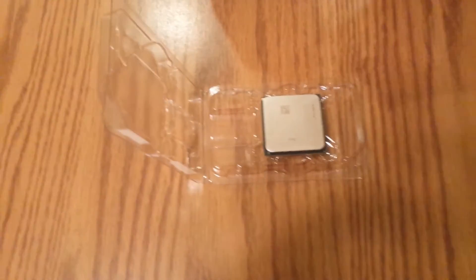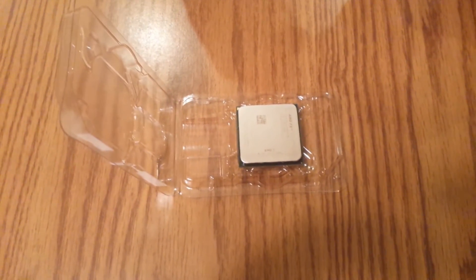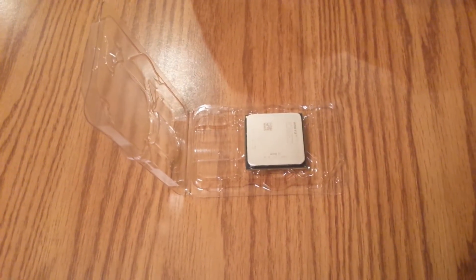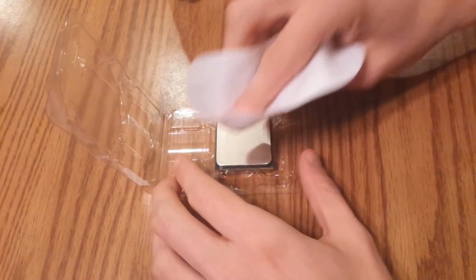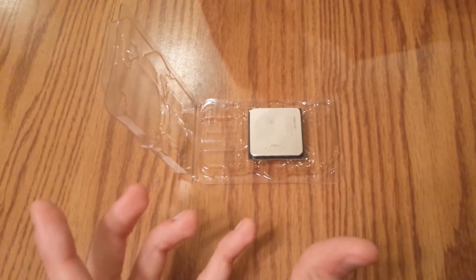As you can see we're cleaning most of it. The number one reason you use isopropyl alcohol is because it evaporates quickly, cleans well, and doesn't leave lots of residue. Lower concentrations like 50% have more water, which dilutes it and introduces more contaminants. As you can see, the CPU looks very clean now.